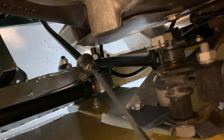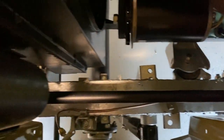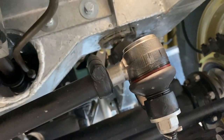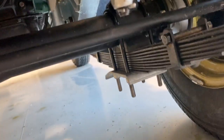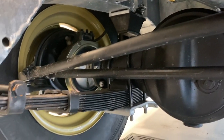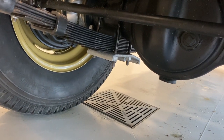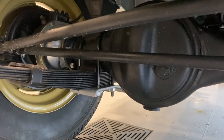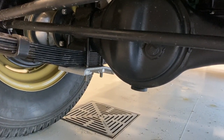We have the steering rods and the ball joints, which travel along the frame rail and go into a steering relay, which is a cylindrical gearbox that goes vertically through the frame rail. It gets picked up with these, I guess we're going to call them drag links, and is that right, Dale? Drag links and these steering rods, steering arms. What are these transverse ones called? There's tie rods and there's a drag link. So the big one, the one that runs between the wheels, is the drag link, and then the tie rods go along to each individual wheel.